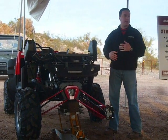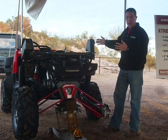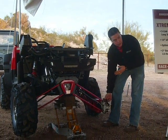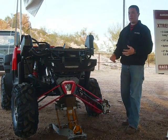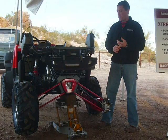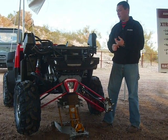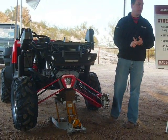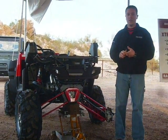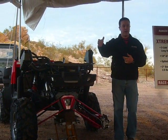We've got constrained optimization. What we're looking at is 64 inches wide, a 4.5-inch longer wheelbase. We talked about the 14 inches of travel here. That constrained optimization gives us a couple of things. We do have minimized and optimized scrub control as we go through travel. Some of our competitors might brag about having zero scrub as they go through travel. That works fine going in a straight line.